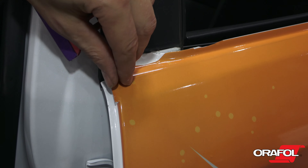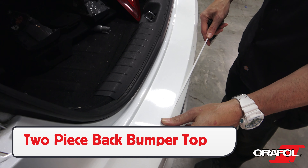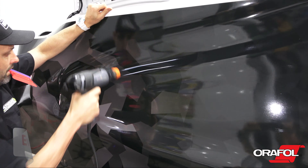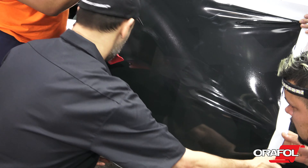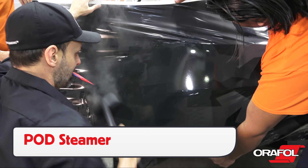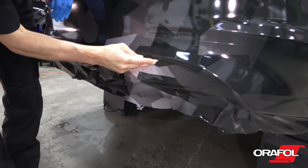For big panels, remove the excess film first with the liner on. Make a horizontal backing paper cut on a body line that is on the 50-50 point. Once this is made, use dry erase marker registration points for easy reference to keep the panel aligned. It's recommended to use two installers to help remove the liner and install the film. Set up a permanent hinge on the middle of the body, and once the film is locked in position, work in stages and keep the liner on.